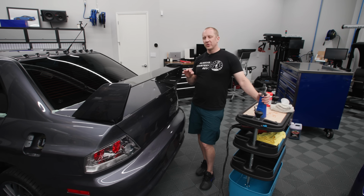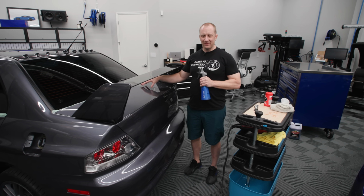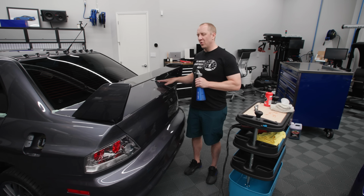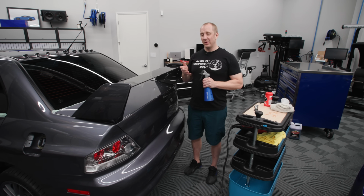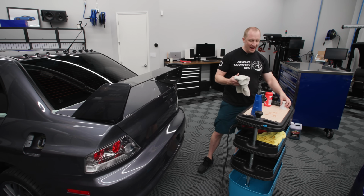But what you need to do first, I learned this from Ivan LaCroix from when he was back with Optimum, you need to chemically break down at least the surface contamination of the water spot. But generally with a spot remover, it's chemically breaking it down, but there's usually sort of the head or the leftover stuff that's sort of squeezed into the clear coat. But if we at least get the vast majority of the chemical removed, then we can polish the rest of it off, and then hopefully they won't come back.